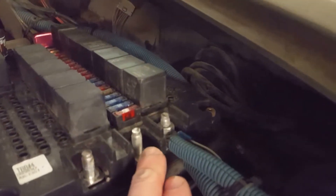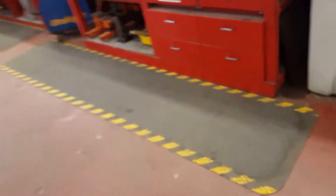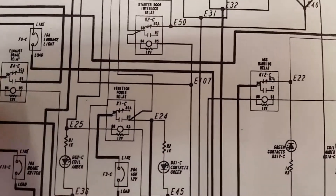There's no output on this relay because we found there's a diode between the ignition and ground, and that diode has failed. We've got a ground connection between the ignition stud and the ground stud. Here's the ignition relay right here.